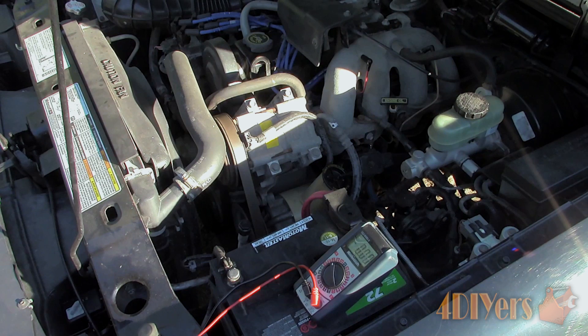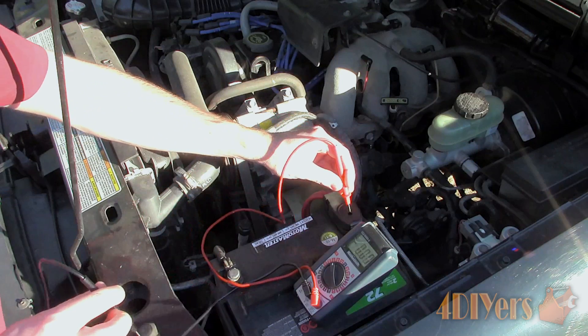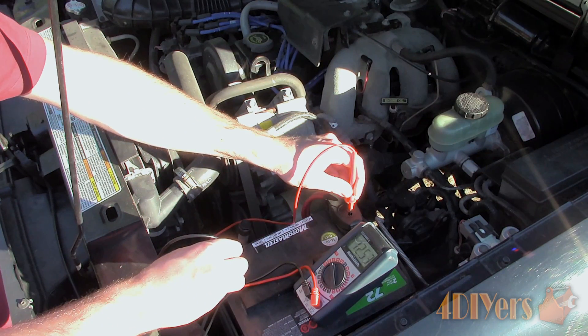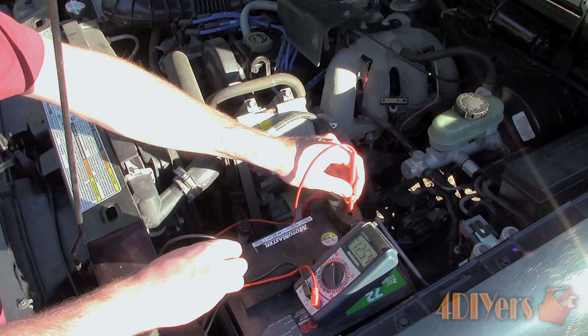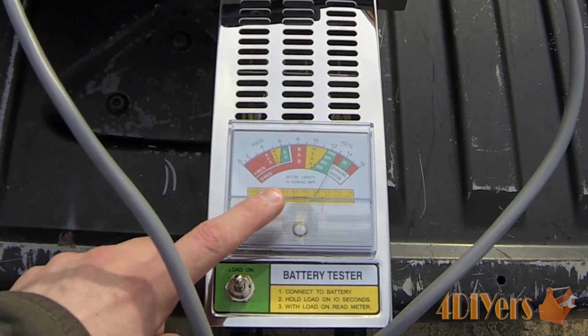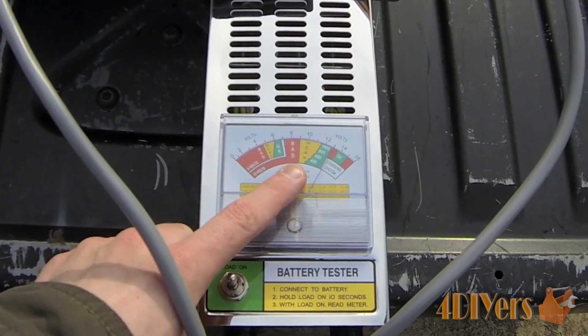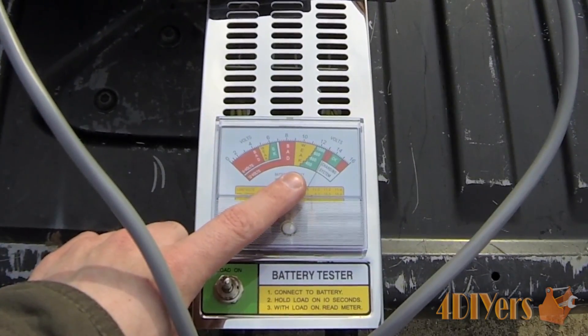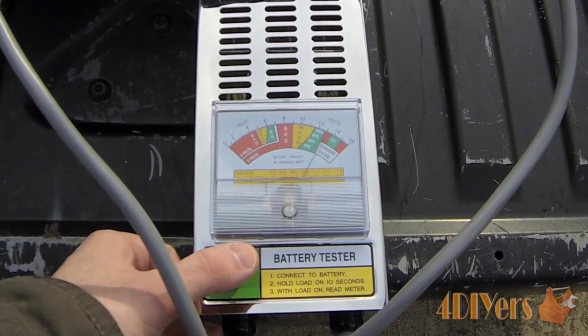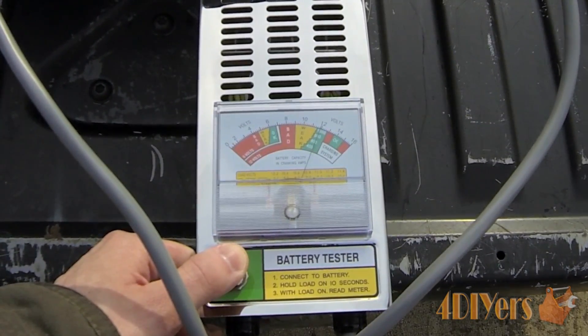Now the battery. The battery might be either low on voltage or unable to handle a load. First, measure the voltage with a multimeter — a fully charged battery should read between 12.7 to 13.2 volts. If it's 11.9 volts or under, then it's completely discharged. A load test can be done on a battery to determine its condition. Ensure the battery is fully charged before performing a load test. You can also swap out the battery with another vehicle if it meets or exceeds the requirements.